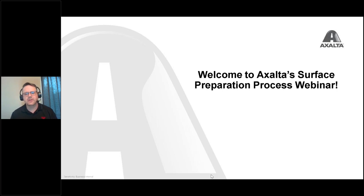What we really want to talk about today in this webinar is the basics — surface preparation. One of the things that's important is you can be the best painter in the world; it doesn't matter if you don't have a good surface to start on. Whatever you do on top, it really isn't going to matter at the end of the day, and you usually end up in costly redos. I was working in a shop yesterday and unfortunately they prepped something using the wrong sanding grit — it was silver — and you could see sand scratches. That ended up being a redo just by not following best practices of surface preparation.